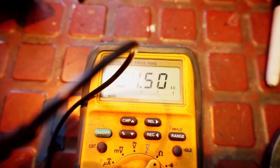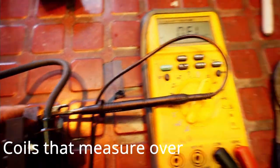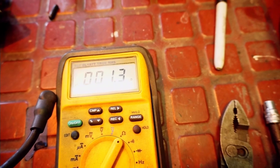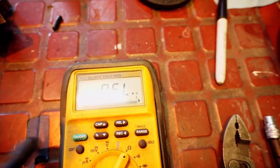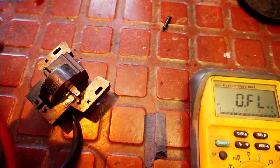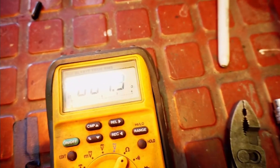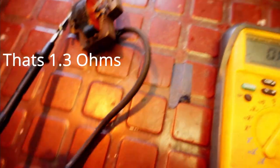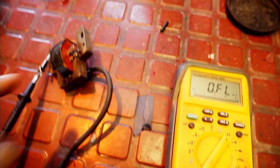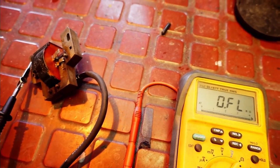Okay, 4.50 - very, very small difference. See, it is a different reading because it makes a difference. Now if you want, you can also check a couple of different ways - you can check to the ground wire with the grounding lug here. 1.3 ohm - so it's almost a direct short, there's a little bit of electronics in there. That's what you're doing - you're actually sending the signal for the coil to shut off. It's not just grounding it; there's electronics in it.